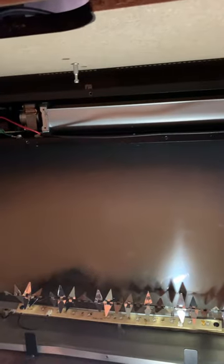Now you can see what it looks like. The issue here is this heater blower up here. This is the one end. I can't zoom out any further because I'm up against the wall, but this is the top of it. Once the panel is off, what you need to do is clean this thing, the lint and all the crap out of it.